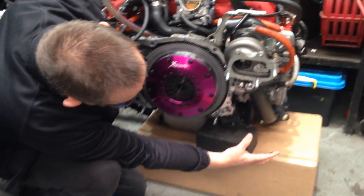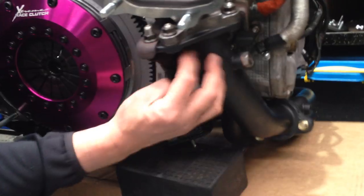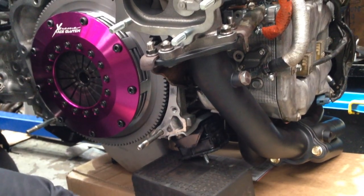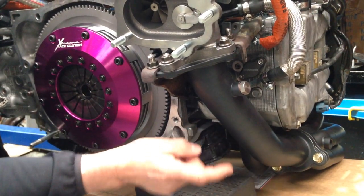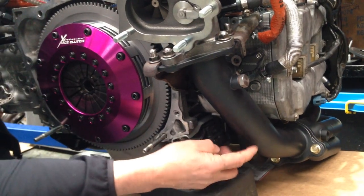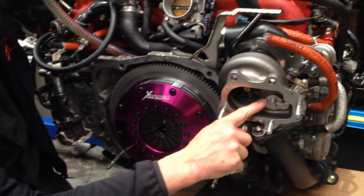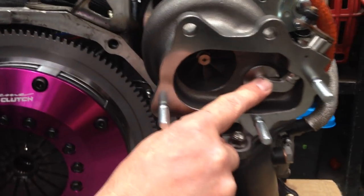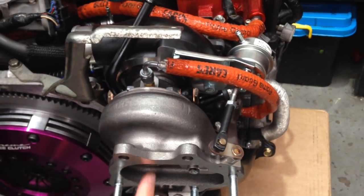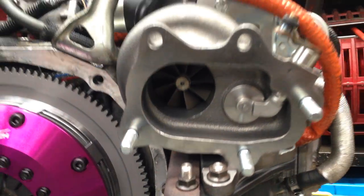We were also talking previously about the exhaust manifold being HPC-coated. This part here is typically the up-pipe, which on some early model Subarus like GT Foresters and early model Bug Eyes have got a catalytic converter — check out our video on that. This is where it comes out of the exhaust heads, up through the exhaust manifold, into the underside of the turbo, and out the back of the turbo here. This is the waste gate, controlled by the diaphragm here, which is in turn controlled by the ECU for boost control. Inside here is where the main energy comes out the back of the turbo and then down out the exhaust.